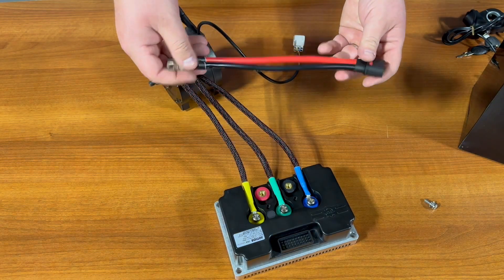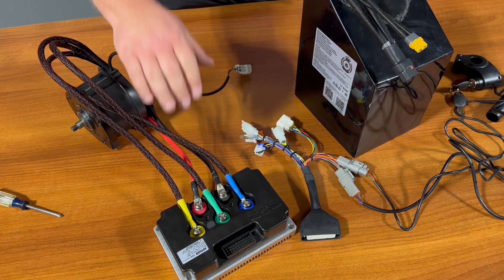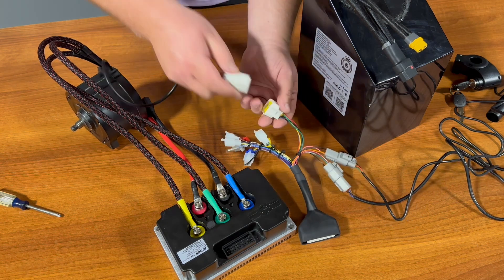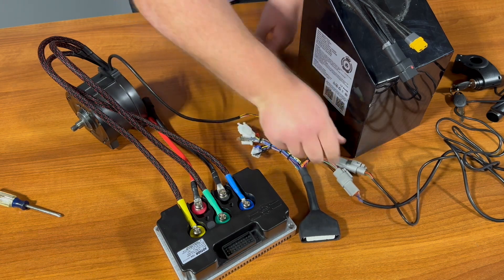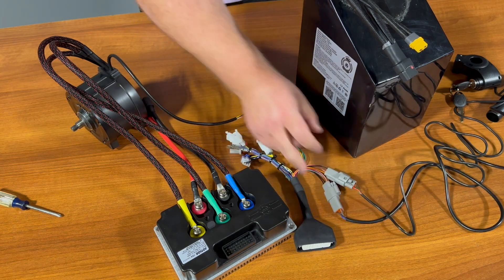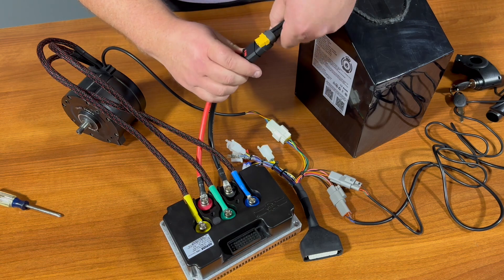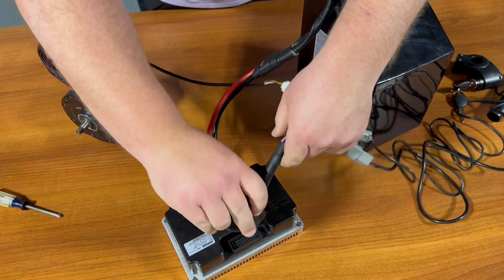Next, we're going to take our battery leads. This battery lead is a QS8 — that'll come with the battery you purchased, whether it's from us or anybody else; they normally always are included. In this last step, we did our three phase wires and also put our battery lead on. Let's take our plug from our motor — the hall sensors — and plug it into the existing harness that has our throttle and ignition with voltmeter. Then let's take our battery lead and plug it into our battery. And the last step: let's take our big controller plug and plug it into the controller.